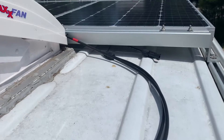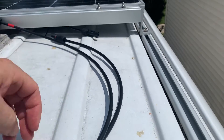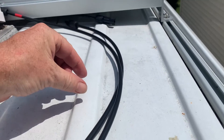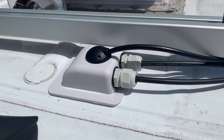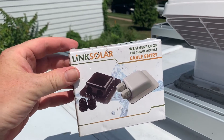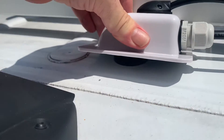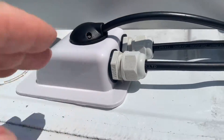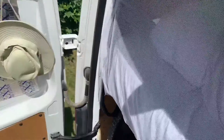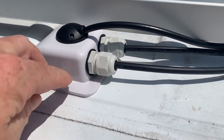Okay, I've run the wires. I don't have them hooked up to the solar panels yet — I'm going to wait until after I get everything connected down below. Basically the wires are coming along the roof, and I'm going to get some more of those little dudes to fasten these down with. They come right under this rear bar, and they go into this roof entry gland, which I got from Link Solar — I will put a link to this in the description. I still need to attach this with some Dicor lap sealant, which is the next thing I'm going to do. They come inside, then they go right along the roof, and then down along the corner of the van — you can see them hanging right down there.